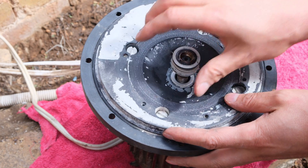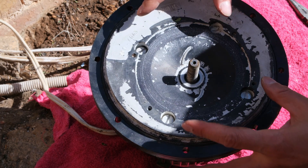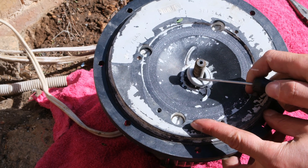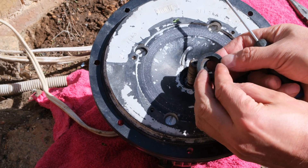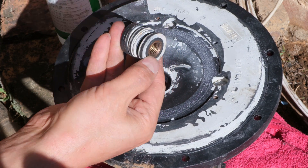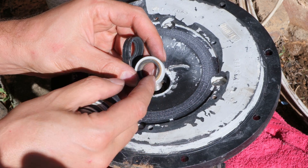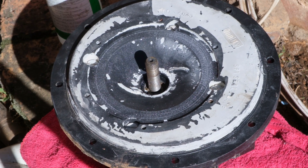Inside there is the old ceramic ring with the seal. You could open the four screws and remove this, but in my case it's not necessary — I'm just going to peel this old seal out. There it comes, and I can remove the old seal plus the rubber. The old seal is in very bad condition: the rubber is fatigued, and it looks like it has discoloured from corrosion, which means water was getting through there — that's why it was leaking.